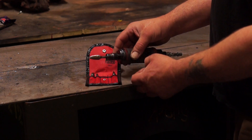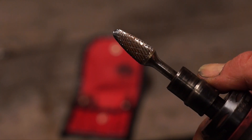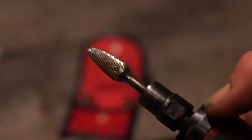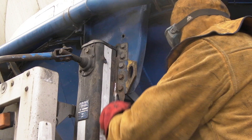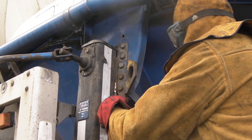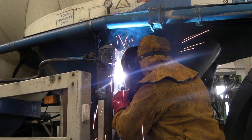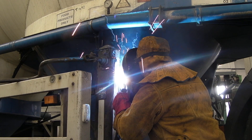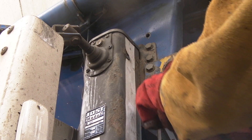So this one on a die grinder — I have some... I can't even remember the name of them. You'll see them on tool vans and advertised on eBay. Don't buy the cheap ones because they do not last. This kit cost about 150 quid and, looking after it, will last a lifetime — especially if it's used on soft metals. I'm just using it to grind out where I can't get an angle grinder in properly. And I'm welding up what was a crack on the landing leg — just drop some weld in there, and that's all done. It's a tool to clean up stuff and you'll be surprised how useful it actually is.